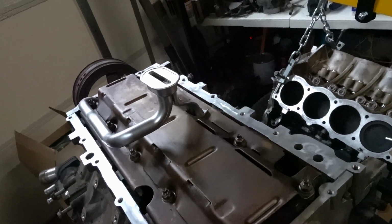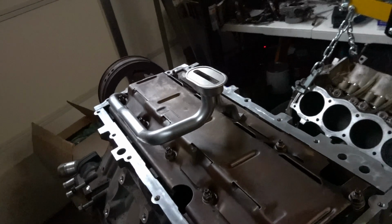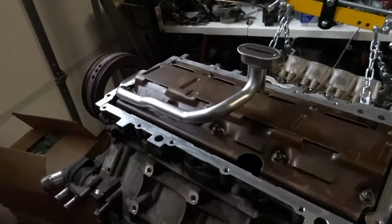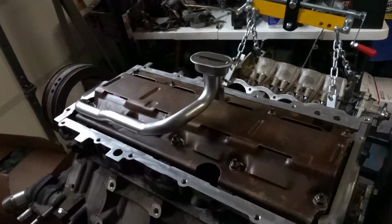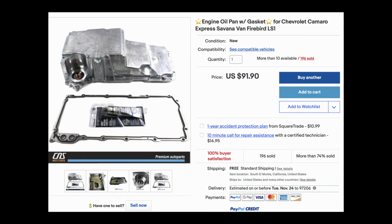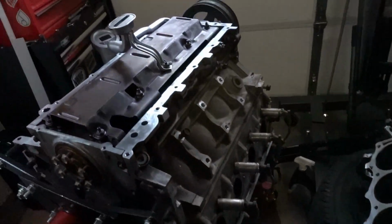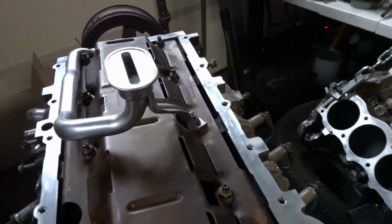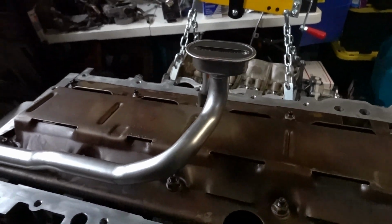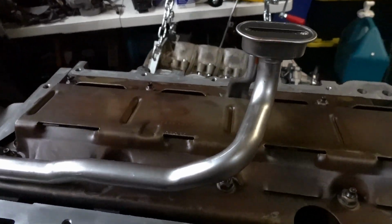What we're doing on this is we're replacing the oil pan with something that looks a little bit more like the Land Rover's oil pan. I'll come over here. You see that. It's going to give it enough clearance to meet the steering arms, but because it's a different shape, we have to use an oil pickup tube that's slightly different for that oil pan type.